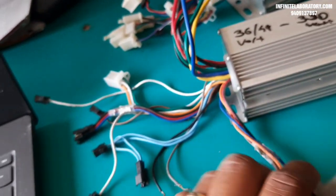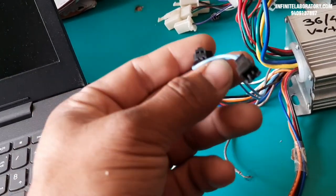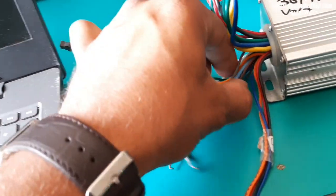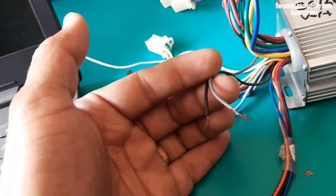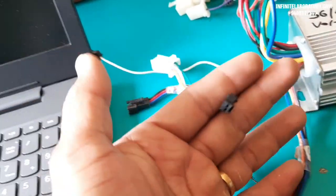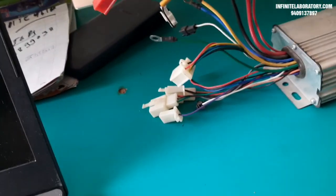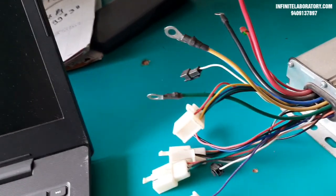There is one wire for cruise control — connect it if you want cruise control for your motor. The red, black, and gray wires are for electric brakes — connect these to your brake system. Another wire allows you to supply 12 volt positive to activate a high brake function. Every controller may have different functions available.